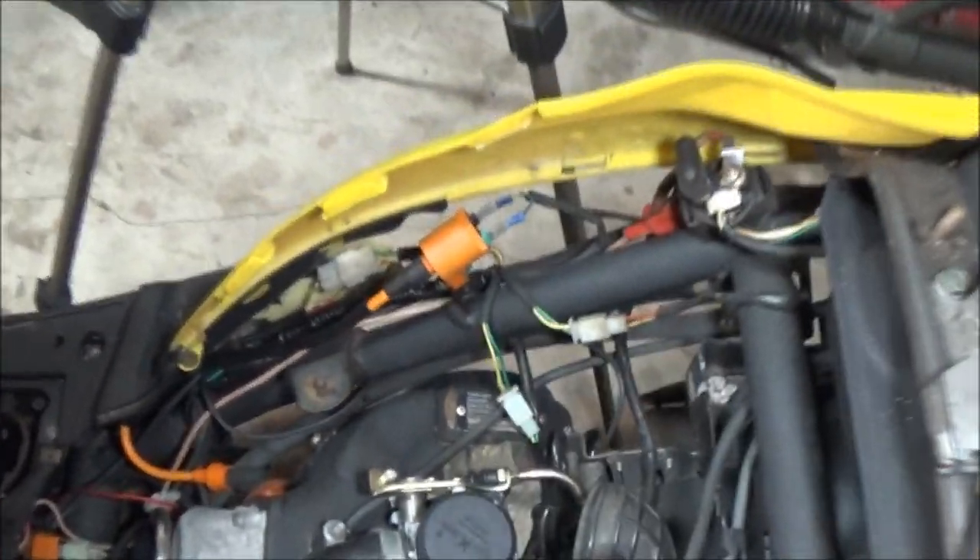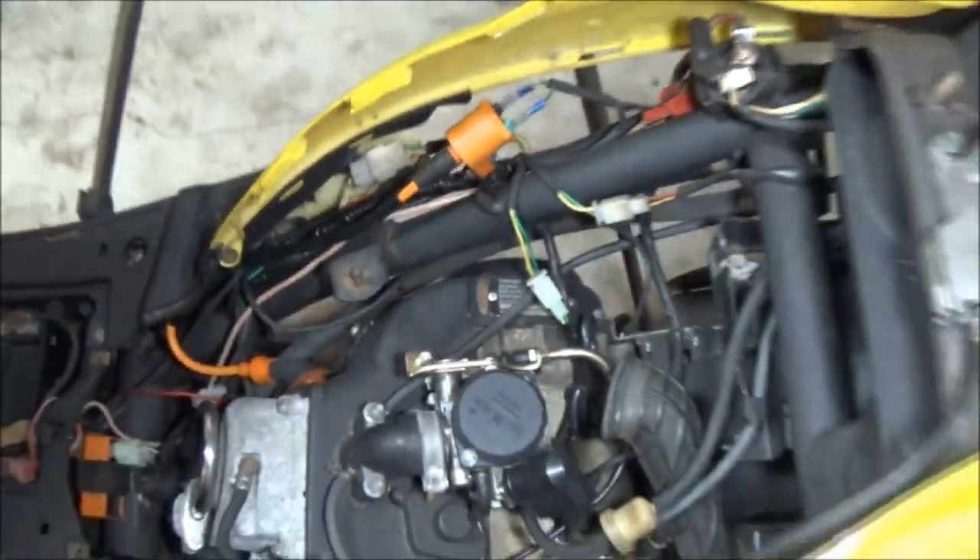So there's how you change your throttle cable on - I think it's a 2013 Propel scooter. It's one of those, you know, it's not a name brand, it's not like a Honda or something. I think it's a 49cc - they consider it a 50cc but it is upgraded. I do have the upgraded ignition system on it, and the mirrors are not original, someone has upgraded the mirrors. I'm going to get everything I need to get this all off to do the tank next, because I know the tank is dirty. I may also have to pull that carburetor off, soak it in carburetor cleaner, take it apart - we'll just have to see once we get there, and you guys will be with me on that too. Thanks for watching!